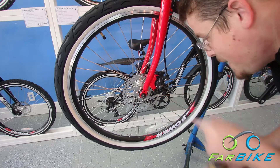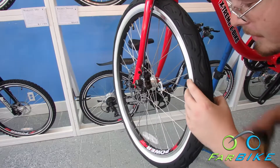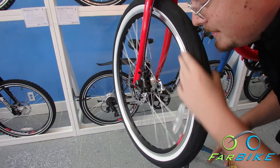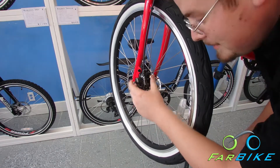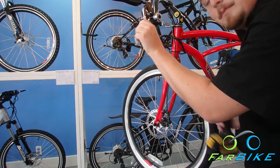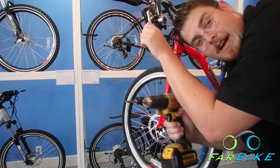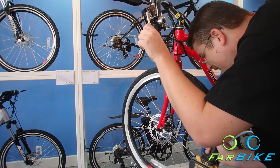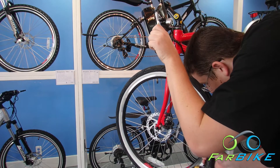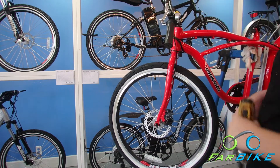We've got the mount in. The caliper itself is still loose, so we need to tighten these two bolts — they're important because they keep the disc from rubbing on the brake pads. The easy way is to pull the front brake handle so it closes around the brake rotor, which lines it up. Then take your drill or Allen key and tighten it slowly and softly so you don't misalign it.